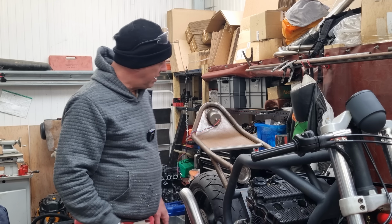I've also done a little chicken sketch of what the inserts are going to be, which is going to go top and bottom, making them out of this stuff. Right, this is Delrin. I think Delrin's actually the brand name, but basically it's an engineering plastic. Really, really easy to machine. And they do all sorts of different plastics for different applications. Like, some are good under load, but if you want something to slide over top of it, can't remember the name of it, but that's the green one. And there's like a whole load.